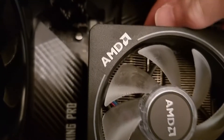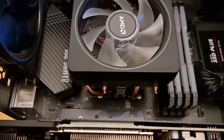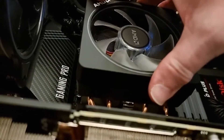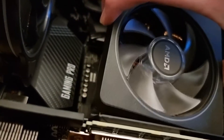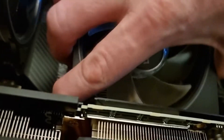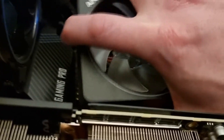This is the fun part, trying to do this one-handed. It's also good to remember that once you get these clamps off, never pull the processor or the cooler straight up — it can actually rip the processor out. So if you give it a little wiggle sideways it should leave the processor where it is. And as I said before, I ran Cinebench before doing this, got the temperatures up in the processor — it made the grease a lot softer, so much easier to remove.